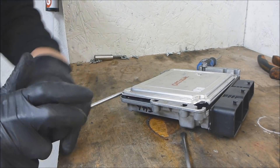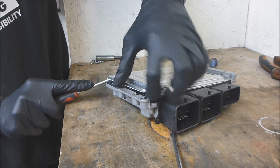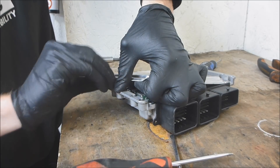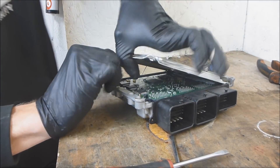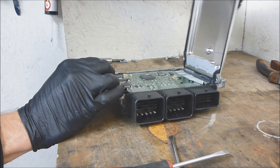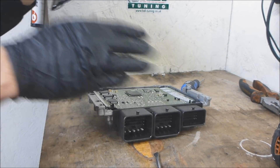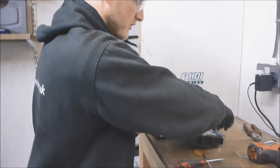Once you've got a big enough gap, you can push down on this part just here. There you are — you heard the glue break. Now use both hands and push the lid up like that. You could also use a Stanley knife at this point to break the glue off, but because I heated it first the glue is nice and soft.